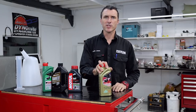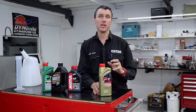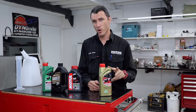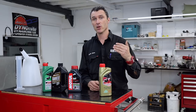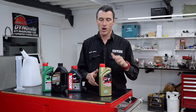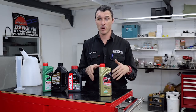First, we're going to talk about Rotax oil. This is the oil I use and recommend — it's Rock Oil Max Synthesis, a fully synthetic oil. You can use any synthetic oil. The reason I like synthetic is it makes jetting way easier. I've had problems with castor oils in Rotax engines, having to get them above a certain water temperature to get them to really crack on at top RPM. Using a synthetic oil makes that problem go away.